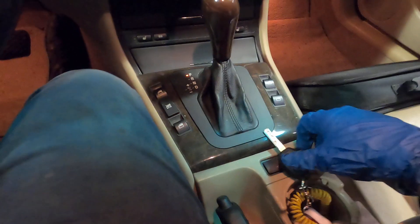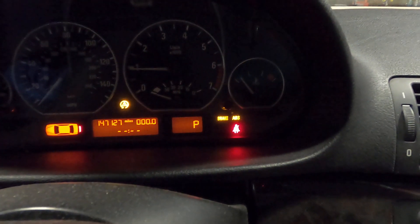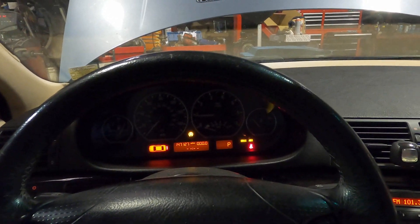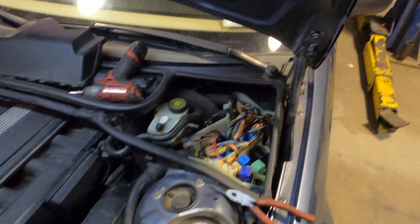Battery hooked in - let's see if it starts. It starts! Brake light and ABS are going to be on for me, along with the emergency light, because the trunk's open and we disconnected the battery. But this should be the last thing pretty much on this whole menu. The only way we're really going to find out is if I'm able to drive for more than a week without it stranding me. I'll still be using the scanner in here just in case. Hopefully it doesn't strand me - but it starts, and that will disappear once I start driving. So that in my book is good. Now that we know the car starts, the new DME aka computer is in and the battery is connected - let's put the cover back on and clean this up.